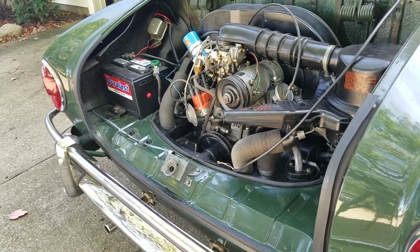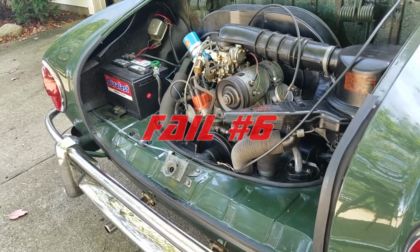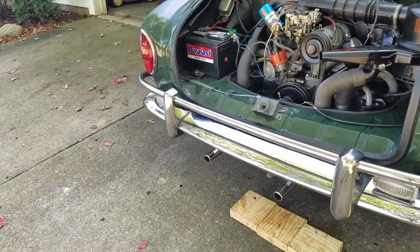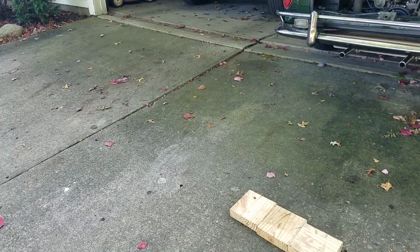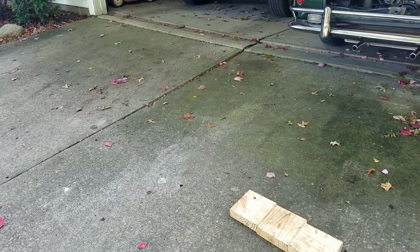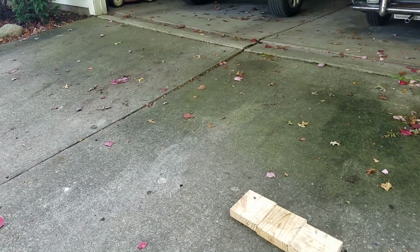If you're following along, I'm already up to 5 fails, but here comes the biggest fail of all. After I assembled the engine, I set the valve lash. However, the number 1 cylinder push rod wasn't seated in the lifter, so when I started the engine, it banged against the rocker arm and hammered the number 1 lower rear cylinder head stud. It weakened the threads and caused the number 1 cylinder head to leak, but I didn't realize it at the time, even though there were obvious clues.